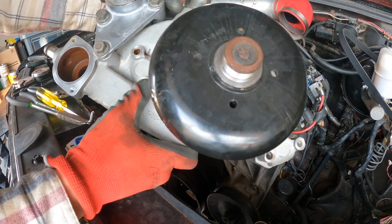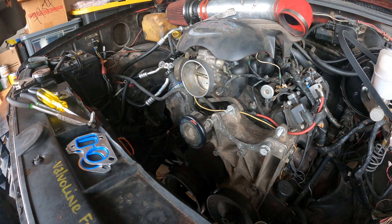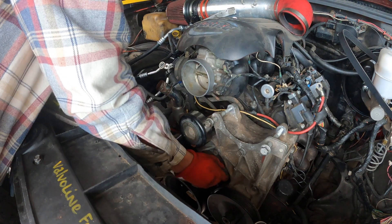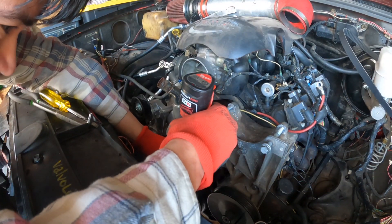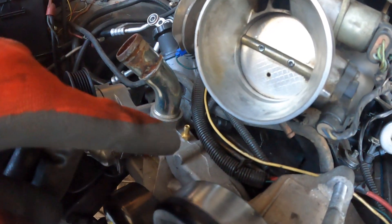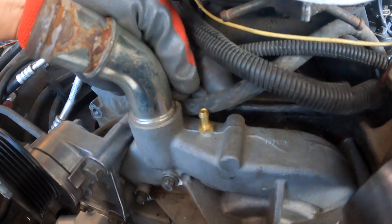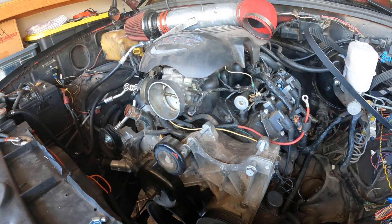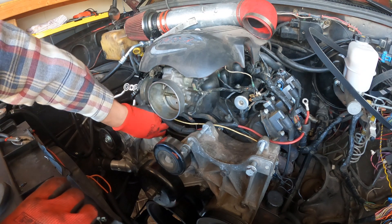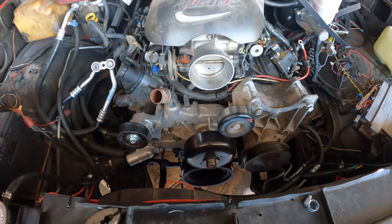It's the next day - got the water pump cleaned up and got the fitting threaded in there with some thread sealant on it, so we're gonna put it back on. I cleaned off the mating surfaces and we got some new Fel-Pro gaskets. Now I'm going to torque down the water pump bolts. We can actually see it coming out from back here right under the throttle body - shouldn't have any issues there. Go ahead and cut it and put the hose clamp on. That looks pretty good to me, as long as I don't have any leaks - everything's going pretty smooth.